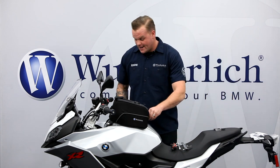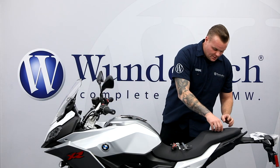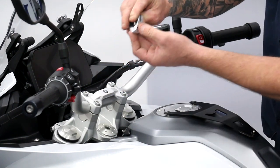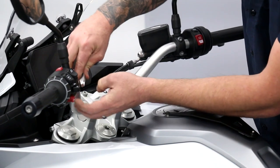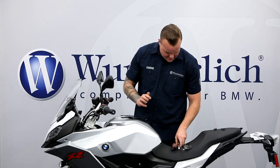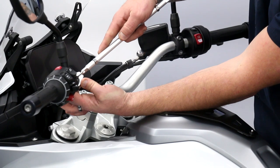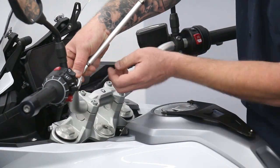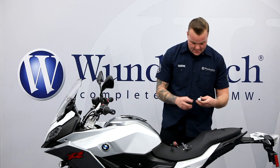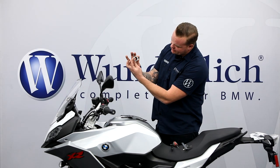We're going to be removing our sport bag to get a little more room to work with. Take your hinged buckle and wrap it around the bar — you want to wrap it in such a way where you're going to be able to get to the head of the fastener. Let that hang out there until we get the other one in. Go ahead and take this one off with the T25, reinstall the crossbar into the buckle, then assemble the other buckle with the spacers. Just make sure you've got good fitment.